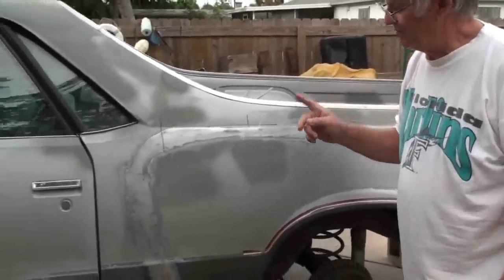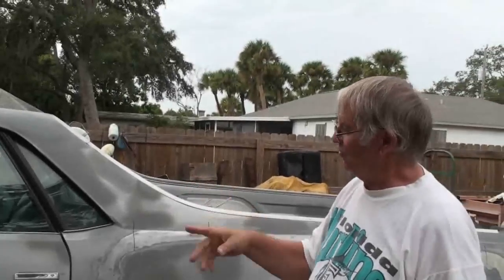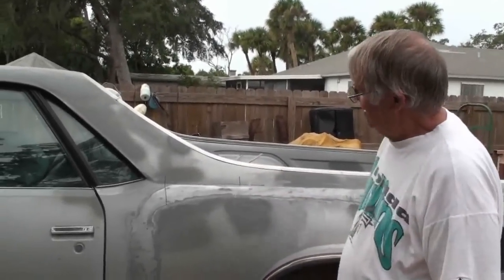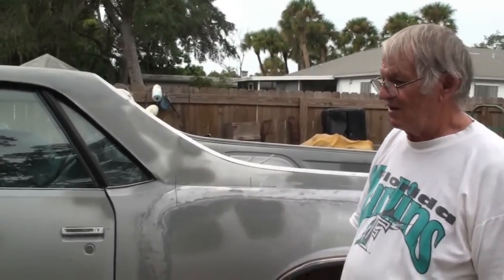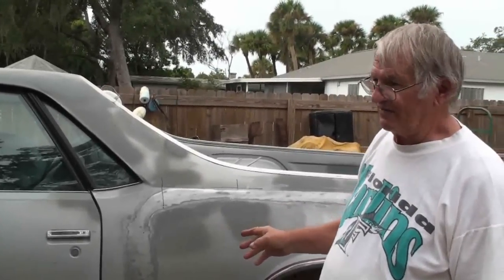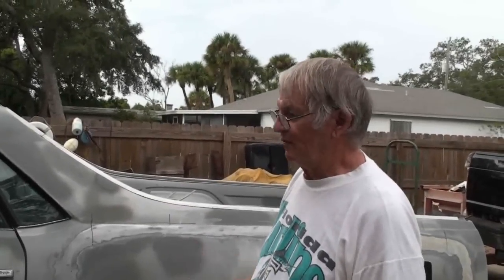We'll put the bonding material on the bonding strip before we put it up here. Then with it on there, we'll bring it up here, put it on, tighten all the screws down, then scrape off the excess. Which you've got to move pretty quick when you do this, because you haven't got a whole lot of time before the bonding material starts setting up.